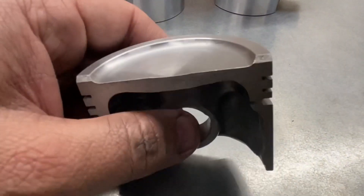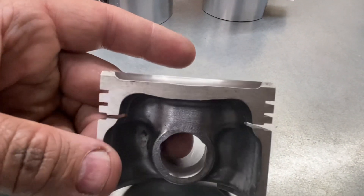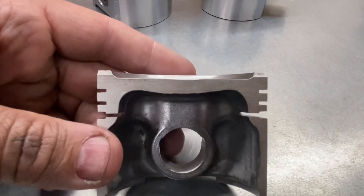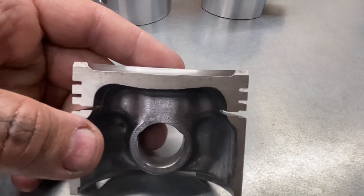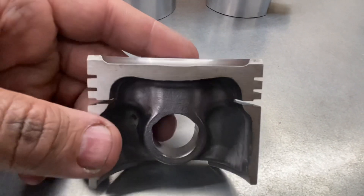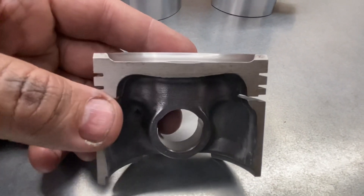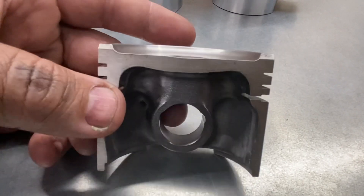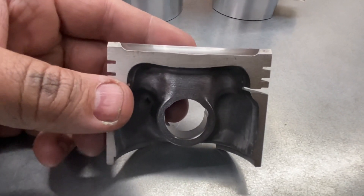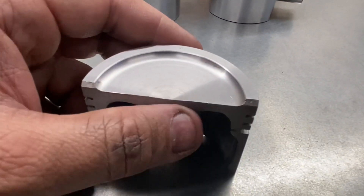Now clearly it's cut in half so it doesn't measure that now, but that was the target on this. The reason we cut it in half is so you could see what's left of the piston crown. On that particular application, that would take the crown down to about 200 thousandths thickness, which is what I call the limit. Reliable engine builders tell me that 160 thousandths — or 4mm — you can get away with, which may be fine, but that's what I would class as a nice reliable piston. Of course you're free to try your own, but this works for me.